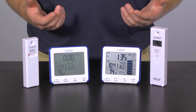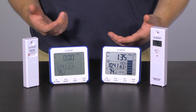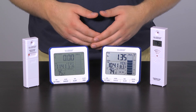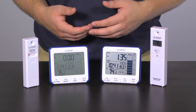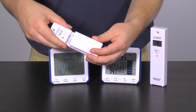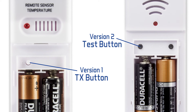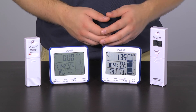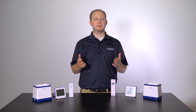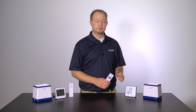The temperature will appear on the display when the reception is found. Now, if for some reason your temperature is still not displaying after you have your station searching for its temperature sensor, go out and open up the sensor itself. You will notice that inside, above the batteries, there is a TX or test button. Press and release this to force a transmission from the sensor to your station. In most cases, this should work. But as stated in the previous video, if dashes are still displayed, replace the batteries in the sensor and move it closer to the station itself.